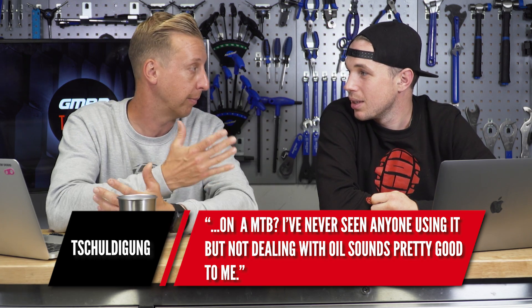Next up is a charger damper question from Greg Brown. He's got a 2015 RockShox Pike RCT3 with a Debonair spring upgrade. He's worried his fork feels a bit slow or over-damped even with his compression and rebound wound fully open. He's happy to work on the damper himself, but would you recommend changing shim stacks or bleeding the damper with a slightly thinner, less viscosity oil?